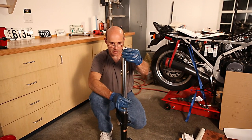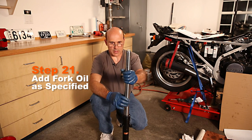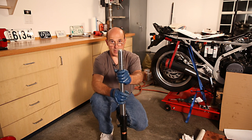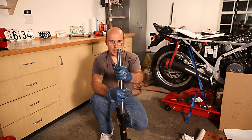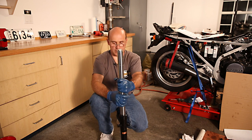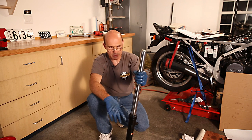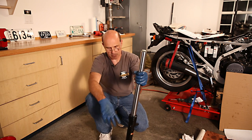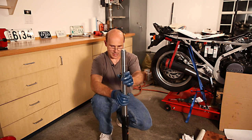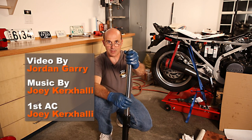I'll be taking this back off temporarily and I will use a precision measuring cup so that I put in the correct amount of fork oil. Consult your service manual for that as well — you want to make sure you put in enough and not too much. Then it's just a matter of putting it back on your bike. That's how you do a fork seal on the more modern bikes. There's a different type of fork used on 70s bikes that doesn't have bushes in the bottom, and eventually I'll have a video showing how to do those as well. I hope you found this helpful and can do this yourself now. Best of luck with your next project. Thanks for watching.